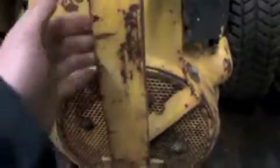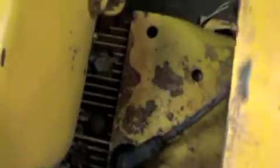It's got some junk under the cowling, and I have to pull that off. You can hear it, it's kind of like a dull thud, so I think there's a mouse nest in there. So I'll probably end up pulling this bar off the back, getting that cleaned out. He said when he picked it up it did run, which is good, ran great. So I'll have to see how it does. It's going to need a starter on it. Doesn't have a starter on it right now. I think I got one on another engine, or I should have one up in the shed I can throw on there.